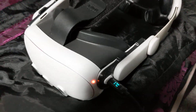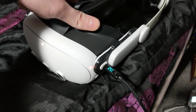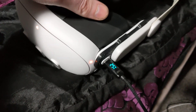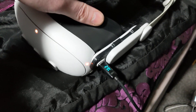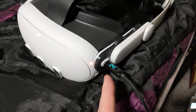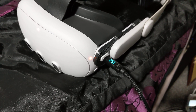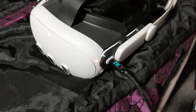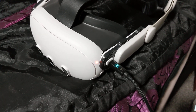If I can get this back in — there we go. This is obviously going to be in boundary setup, but you can see that when it's powered on and in use you do get more power draw, so it's not like the headset can't do it. It's the charge circuit that for whatever reason is only using 18 watts for normal charging. If I leave this — it's 27 watts, 24. When the screen goes off you're going to see this drop. I took my finger away from the proximity sensor so it should go into sleep mode in a second — there you go. And it's plumbing back down to about 11.